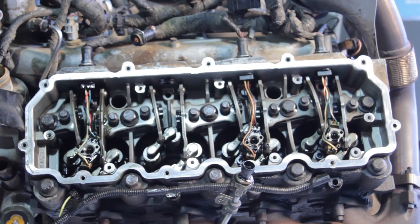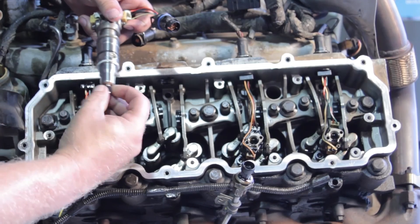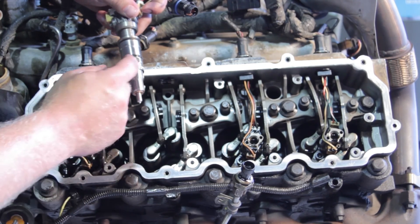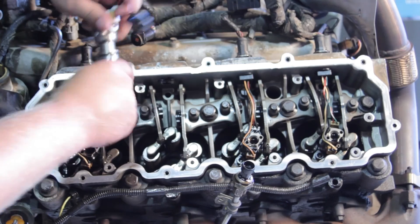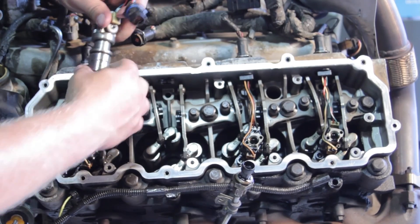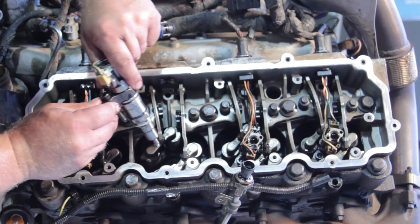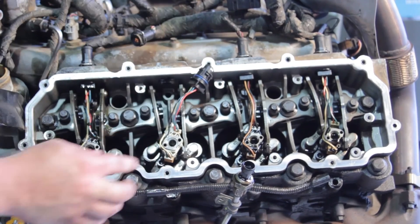Now it's time to grab our new injector. With our new injector, we want to make sure it's got a protective seal on it to keep that tip good and clean. Notice we've got new O-rings on here and it's got a new copper washer. Now we can take some engine oil and lubricate these O-rings — we want to make sure they're good and lubricated before we install this so we don't roll or cut them as we're installing our new injector. We can lubricate this body here as well. I'm going to grab our hold-down and line that up with that tab, and we're going to slide the whole assembly in here together. We'll get it kind of lined up and slide it in place there.